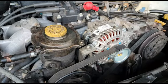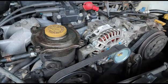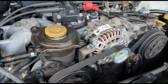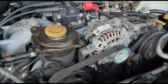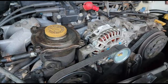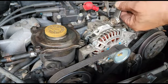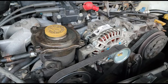You'll know if it's not right because the belt will start slipping and making all kinds of racket. I did check the belt tension before deciding to do this, to see if maybe something was slipping, and it wasn't. Now go ahead and tighten the mounting bolt down. These don't have to be very tight — whoever worked on it previously probably used an impact to tighten them down and that is not needed.